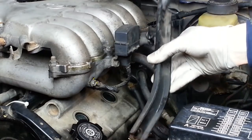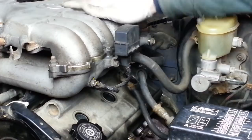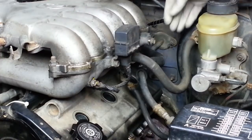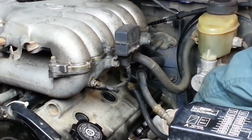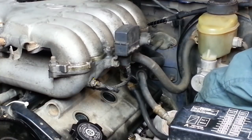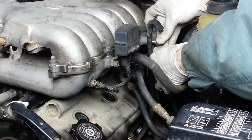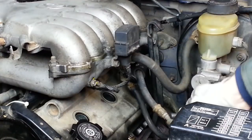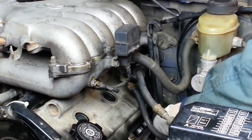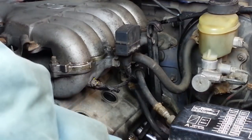Back on the driver's side now to reinstall the intake chamber stay that holds up this end of the plenum. It's nice knowing where my fasteners are by keeping them where they go. Hard to lose them and hard to forget which hole which fastener goes in. There's 30 foot-pounds on these.